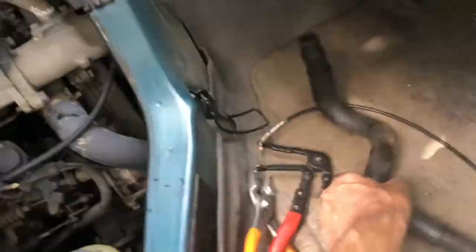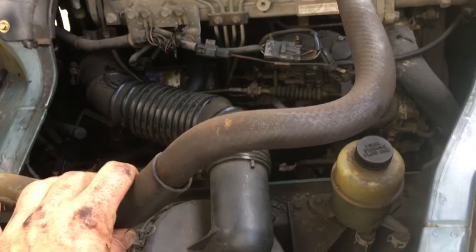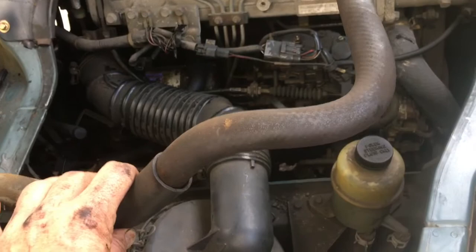If you are going to do this job, make sure you've got the parts first. This part — the pipe over the starter motor on a diesel — I don't know the part number as it wasn't on the bag. You can get it from ADS in Bristol for £40, or off eBay for about £20. Make sure you've got the right tools: this special hose clamp tool lets you squeeze the clamp in really inaccessible areas — without it this job would have been impossible. You'll also need a pair of pliers and tapered corks for bunging up the pipes.